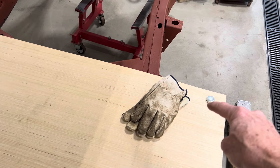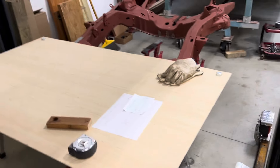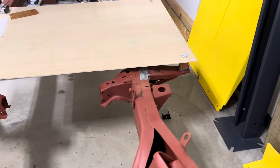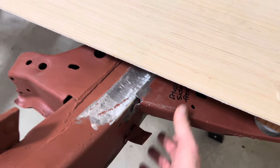What I did was drill those holes with a Forstner bit. In order to make sure the tip on my Forstner bit didn't wander, I bored a three-quarter inch hole and then clamped a guide on the board so there was no wander. So anyway, the plywood got made. I made these little blocks to space the thing up a little bit, and it got the bracket right back where it's supposed to go. So we're going to weld that on today.